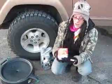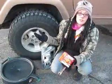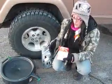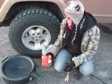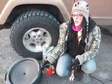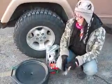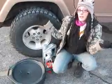Then you have to buy an oil filter that will fit your car, because you have to change the filter whenever you change the oil. And you can also find that out on the little machines at Walmart and AutoZone. And then you need an oil pan, because it is illegal to dispose of your oil improperly. You have to take it to certain places.